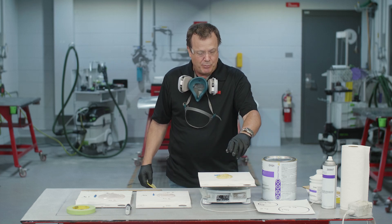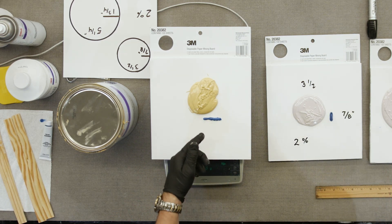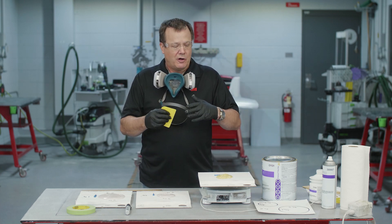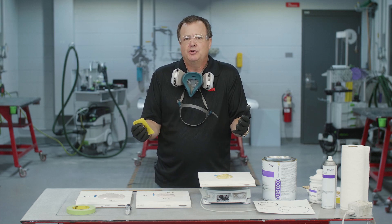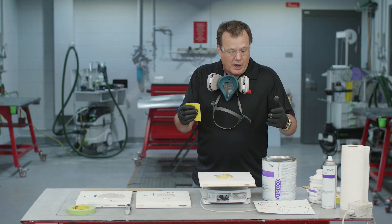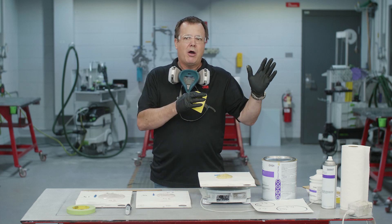You can see I put out 50 grams of filler and then 1 gram of hardener — as close as I could possibly get. The scale moves just from the air, but that's as close as I can get. I did a slightly thinner bead on this one, so it's a little bit longer. You're just getting that range so you're not wildly off the mix ratio. That's your 2%. Some guys mix a lot of body filler — like a quart at a time in bus or truck shops — and it's very difficult to know what 2% of that is, so checking the mix ratio is really important. You can draw this out and hang it by your toolbox as a reference.